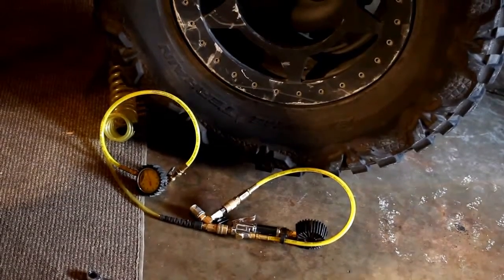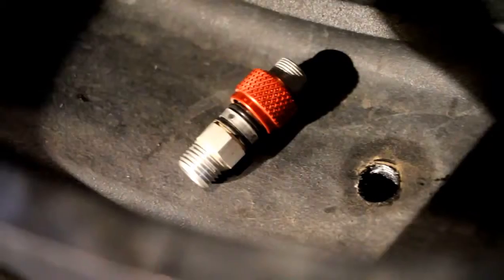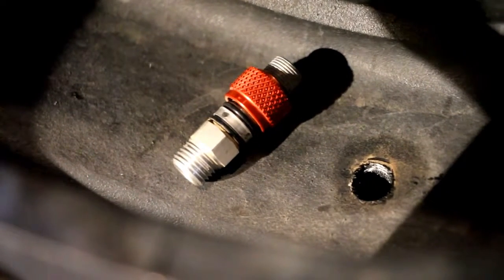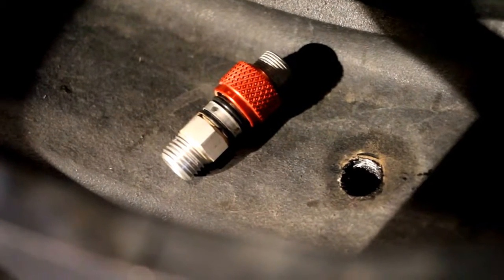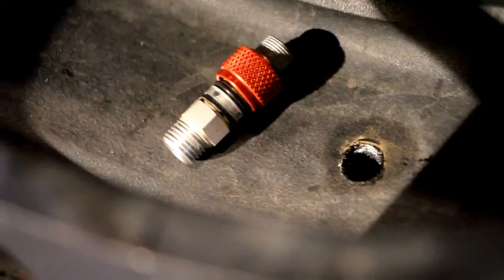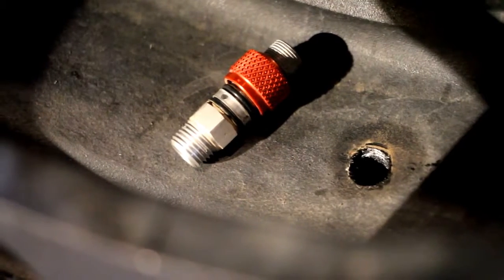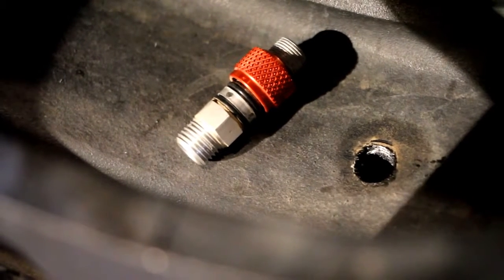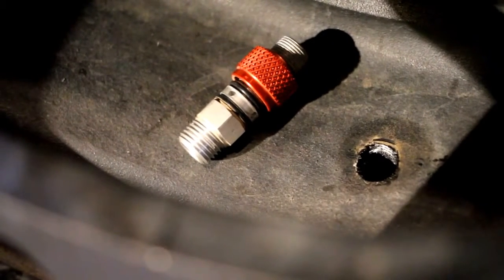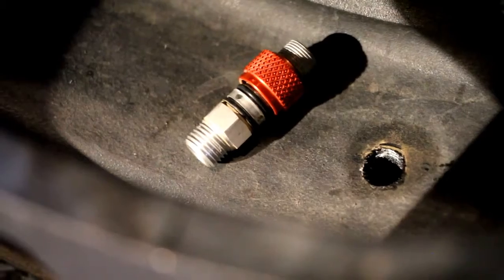So you can see I've got my bead locks going, and I have my Power Tank tools. Alright, first what you're looking at is my rim. I jacked it up off the floor just to take the weight off of it. And this is a little easier for me because I have monster valves from Power Tank. So these are significantly larger. That hole you're looking at is just a little smaller than a dime. And so all I have to do is back these out to get the project started. Now you can just pull out the regular tire valve if you don't have monster valves, which I'm assuming you don't, and this will still work going that way. You don't have to break down your bead locks or rims in order to unconventionally balance.